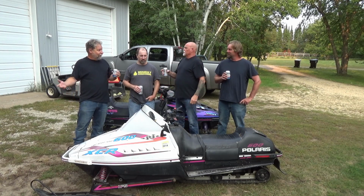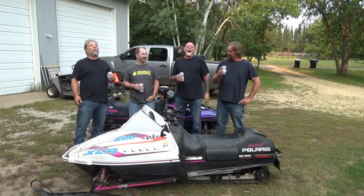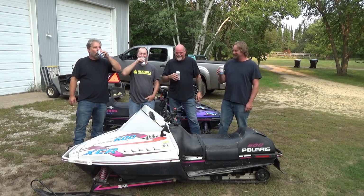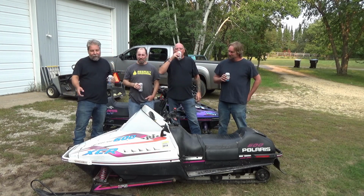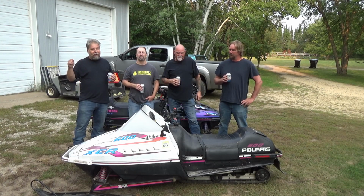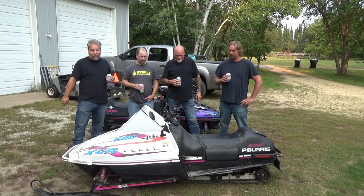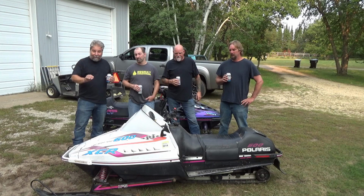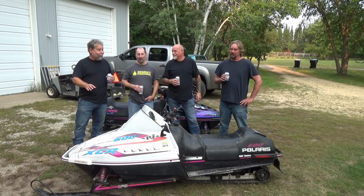Probably. We got the carbs clean. They are synced. Yup. So for a first test rip without doing any clutching, any jetting, anything, blowing out tons of assembly oil out of the motor, plus we have premix in the tank to be sure that we have lots of oil since it's a brand new crank and brand new pistons. So this thing should be rich, and it's warm and it's humid today, and still, I'm pretty damn happy with that. It was fun.